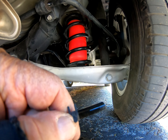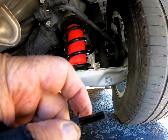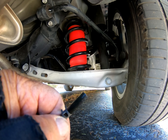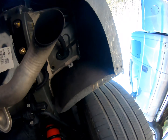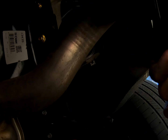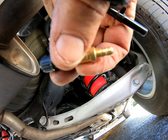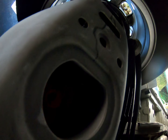Time to put the airline on there. You've got these little clamps that you can squeeze a little bit and they open up, and you can slide it up after this pushes onto the barb that was at the end of the bag. Speaking of barbs — got the one on the Schrader valve. They will push on also. I'm going to try and get the one up under the airbag so we can get a shot of that. You can't even see that puppy.